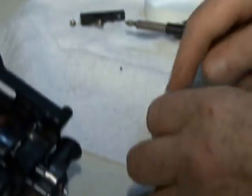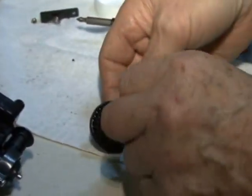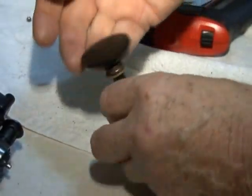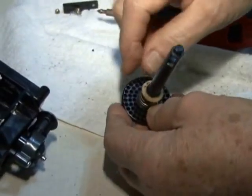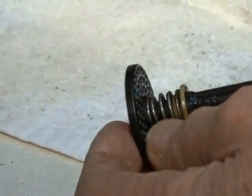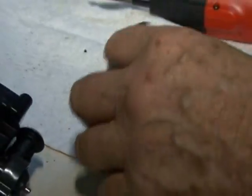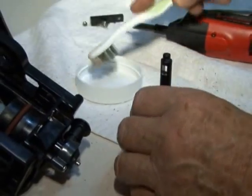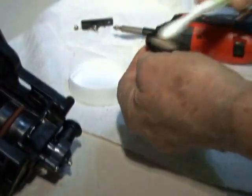Then you push the bottom piston, and normally when there's a lot of tar buildup, it can be so much that all the holes are blocked. You can see right here that they're already cleaned, but all these holes should be open. I've seen it where there's almost a 1/8 of an inch membrane that keeps the water from coming through and making coffee. And if it's dirty, you use your coffee cleaner. You scrub this and scrub this until all the holes are open.